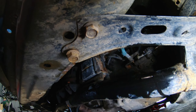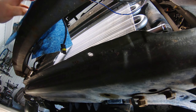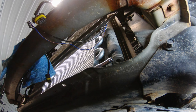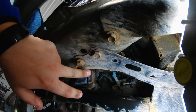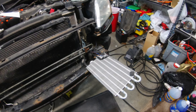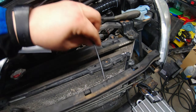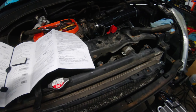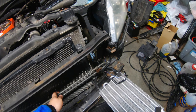I have my transmission cooler mounted like this — this is how I think I'm going to have it because there are holes in the bumper that'll be perfect for getting airflow. I'm just going to have it upside down, but the hose won't reach and the parts stores are closed today. The hose from here is going to go up here, and from right here is going to go back there. If you're doing the same thing on the same car, chances are you won't be able to get this pushed all the way through because there's a fan and fan shroud at the bottom.